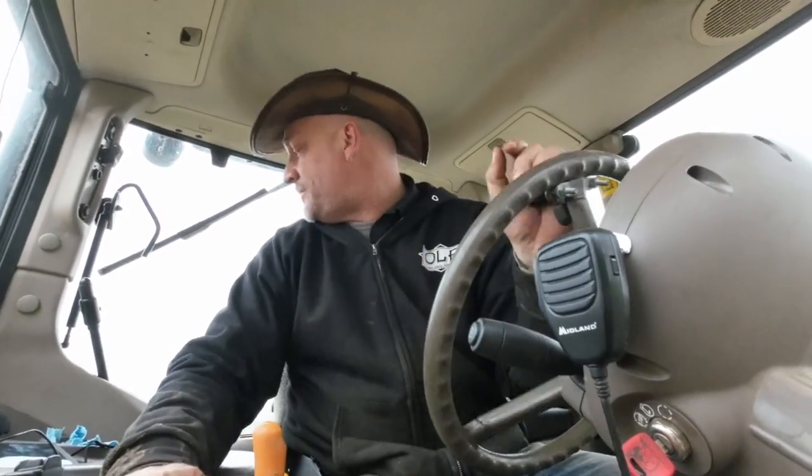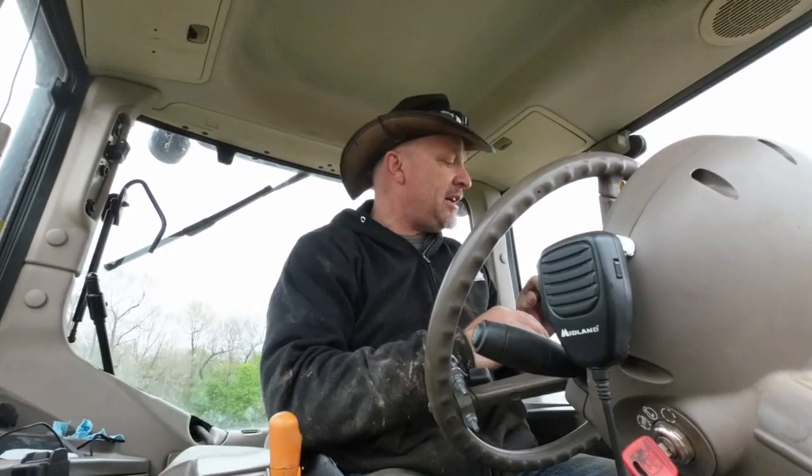I'm going to have to buy some nuts. But if you didn't know, if you've got a nut that's stripped out and it's not terrible, like there's equal wear between the nut and the shaft, or the threaded bolt or pin that you're putting this thing onto, you take a hammer and you whack it and make it slightly out of round, and then it's like a lock nut, and you can put it on and life is good. And that's what I did. So I've got a castle nut that is slightly oblong, and it works.